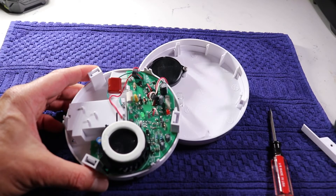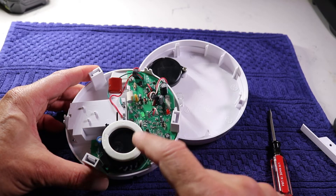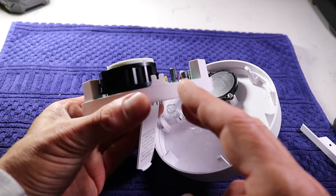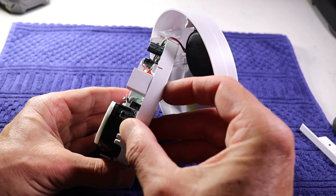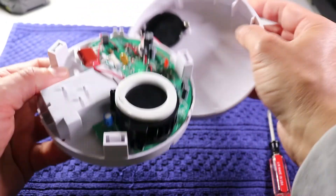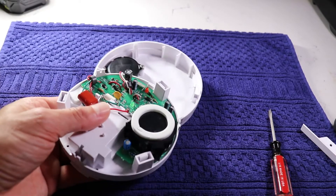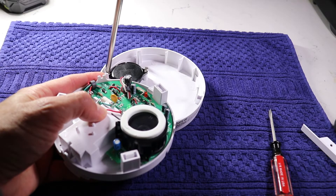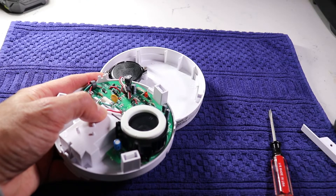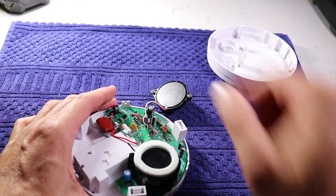We're going to remove the baffle on the left and the buzzer, which is on the right — that black circle up there. We'll have to unscrew that. The photoelectric detector is there on the left. It has these small vertical slots that go right around the unit — they're very small, but spiders can somehow still get in there. With that said, spiders can get in but for some reason they can't get out, and compressed air can't get in either. That's why you have to take this apart.